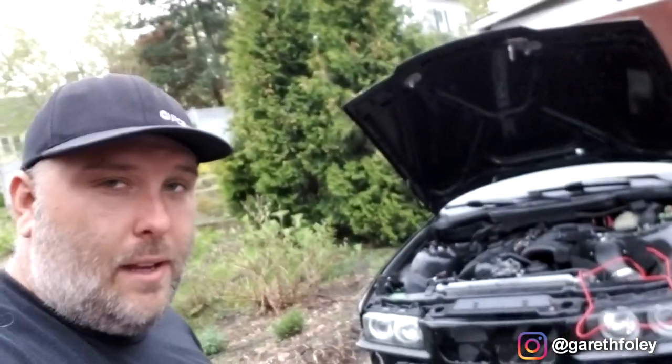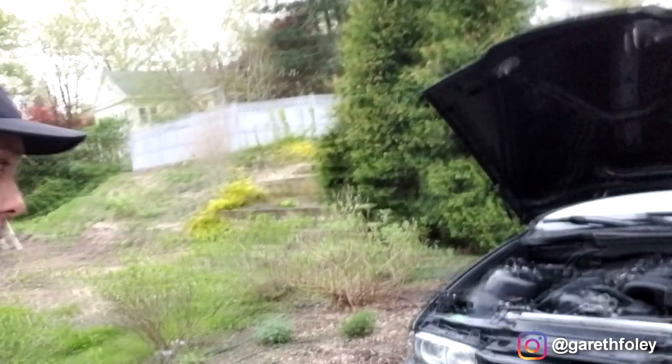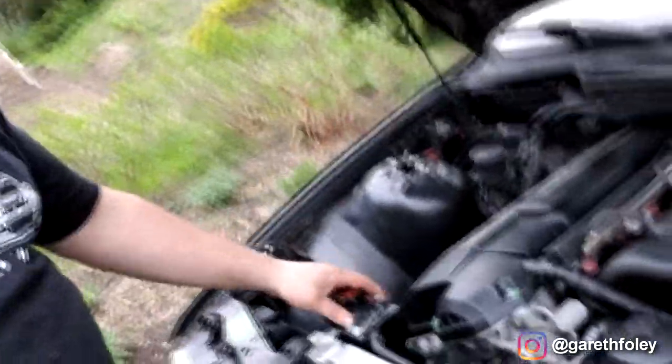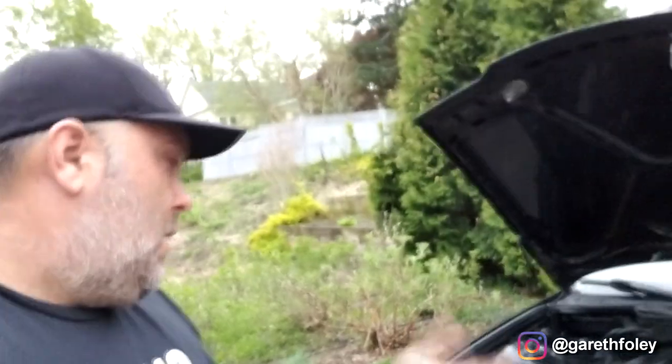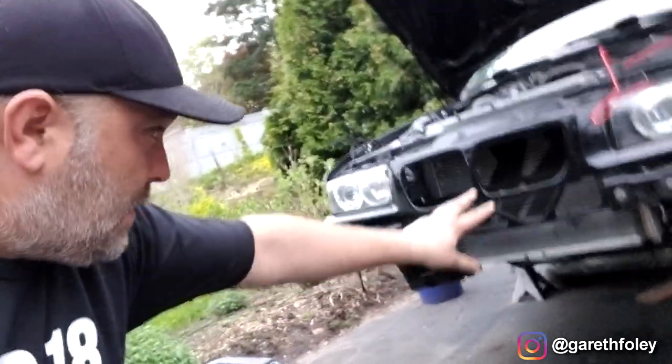I know I didn't talk too much in this video — most of this is pretty self-explanatory. I just wanted to put a quick video together showing how to put the front clip back on and get the radiator and everything else back in. Obviously space is a little bit tight and I'm going to make some changes as time goes on, but I'm pretty happy with it. Between the Mishimoto hoses and the fan, all of that stuff should be in a pretty good position. One thing I'm considering is making a screen that will go in front of the radiator using something like chicken wire. The reason you do that is when you're following somebody closely on track, they'll pick up pebbles and that could take out your radiator. So you want to protect the most critical part at the front of the car, which in my opinion is the radiator.